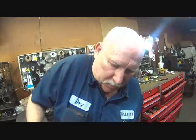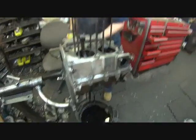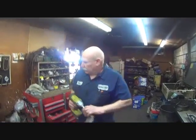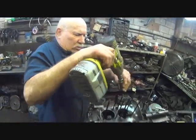I'm tearing this motor down to make sure it's a good core. When you split the cases, you've got to basically tear it down to the bare-bone core of the engine. What are we looking for to make sure it's a rebuildable core? I want to make sure that the block hasn't been bored too far, and also that the thrust hasn't worn too much.